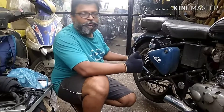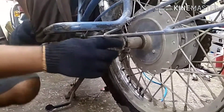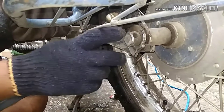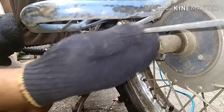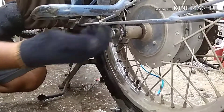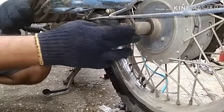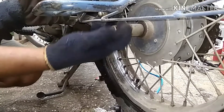On the road I'm not sure whether you can use this tool. This is one end of the axle — as you can see there is a hole in the center of the axle, and here you have to put a screwdriver to pull the axle out. Generally you can't use a longer rod, and if you try, it is very difficult to put it inside because you don't know where the hole will come — the position may change so you won't be able to put the rod inside.